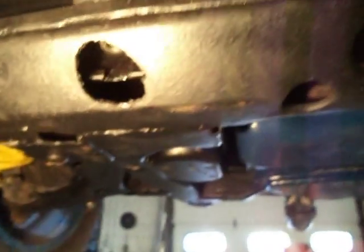Okay, rear engine. What we did is we put a piece of 2.5 by 2.5 inch solid 1/4 inch thick steel bar, welded it right into the frame here, cut a hole, welded it right in. This is the original engine cradle from the other donor car. We had to trim the corners off the sides here to make it fit underneath the frame. Setting up the car to have this, or setting up this to be exactly true and square, was the most difficult part. These are hockey pucks in between, large bolts that are welded right through this and bolted up underneath in here. So there the engine sits.